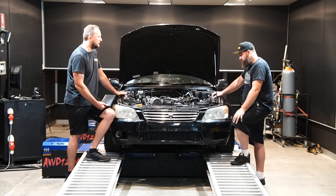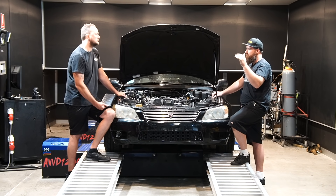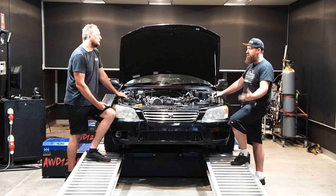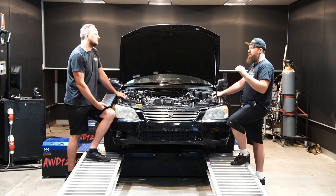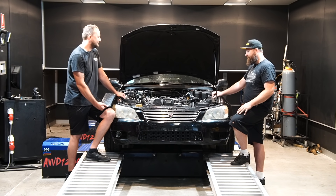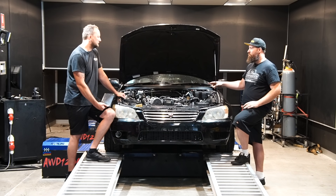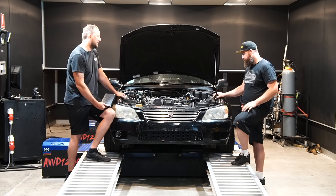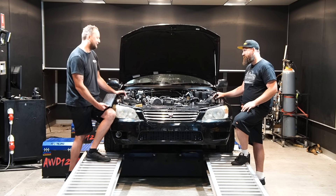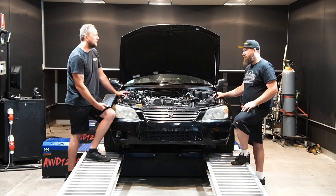Intake air temps were really good — just a little bar-and-plate that Rank One supplied, but they've obviously spent a lot of time on this kit to get it right. It went on really nicely, and at the track, at the drags, and now on the dyno it all works really well together — no one piece fighting itself. The intake temps whether we stopped between runs or went to lunch were always about 10 degrees higher than ambient — that tells me it's sized perfectly. It's also equally not too big to induce lag or unnecessary intake volume. On the track this should be another big improvement.